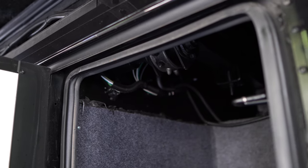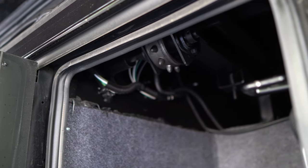The next important thing — MJ is going to show you this — is regarding the slide locks. More expensive motorhomes, diesel pushers, a lot of these slide locks are automatic. How these slides work, at least on the Newmar, is they are pulled in from the bottom — it's a cog design, which we spoke about in previous videos. That cog pulls in the whole slide room on the bottom and stays locked. But this is a big slide — I'm six foot one and you can see how tall it is — and there's nothing pulling the top in from the top. So to secure the top when you're driving and keep everything pulled in nice and tight, there are slide locks.